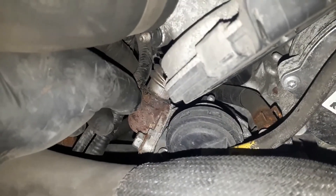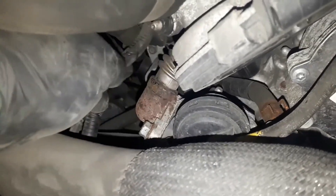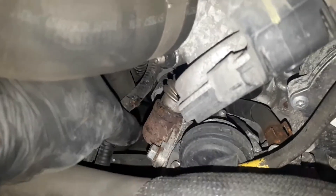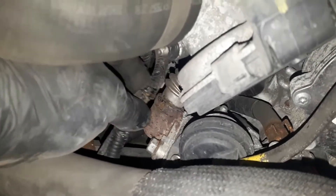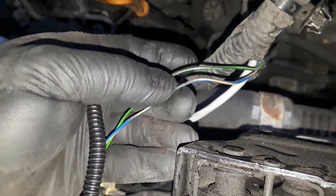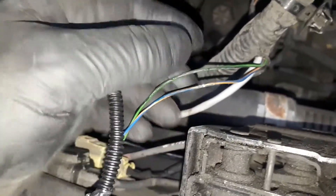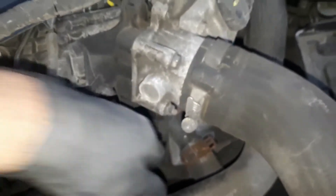This is why we got the low input coolant code. We're going to take the wiring out, strip it all nicely, make sure all the wires are okay and nothing else is damaged. I've stripped down the wires and you can see it's just a bit of insulation gone, touching the EGR. I'm going to add more insulation on top of that and reroute the wire so it will not touch the EGR pipe, and then test it again.